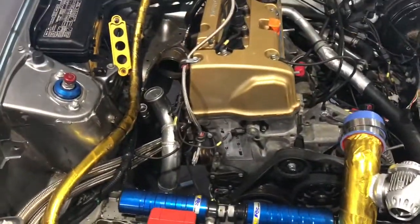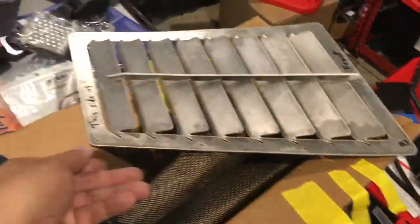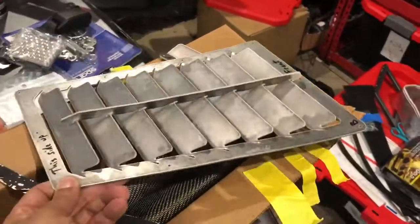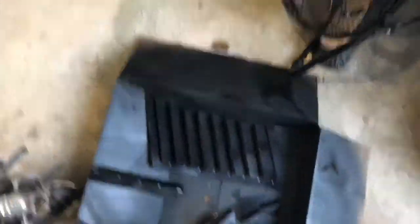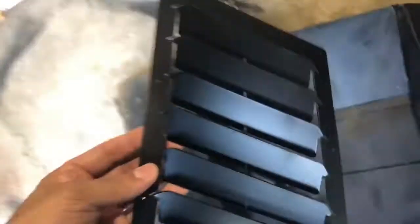In addition to that, we're going to be running oil and water lines to the turbo. We're also going to be cutting a little hood vent here — I got this vent online, it came in a pack of two. This little piece of aluminum was cut out flat and I curved it, then started bending these pieces and lining them up so they all work well together. I'm going to do just one on one side to get that nice offset look, and we painted them up.